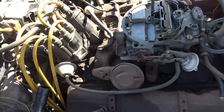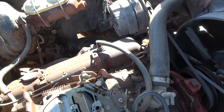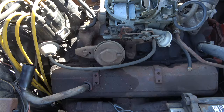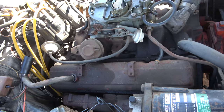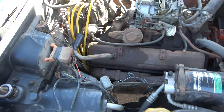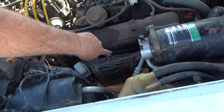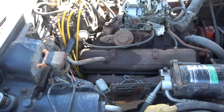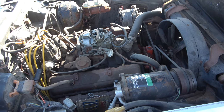I'm gonna clean the intake when I get a chance — look at that, it's been sitting. What you want to do is cover the carburetor and the alternator, then I'll pressure wash it. I'll change the oil later. Obviously these valve covers leak — see the oil there? That's a sign of a bad gasket. It's a great motor though. I started it before — I bought it a week ago.